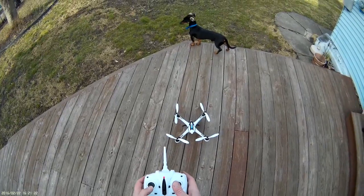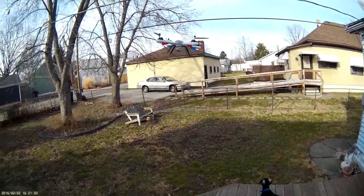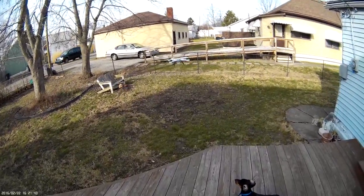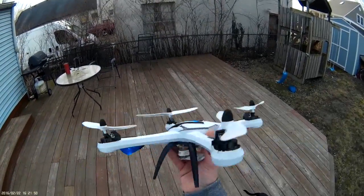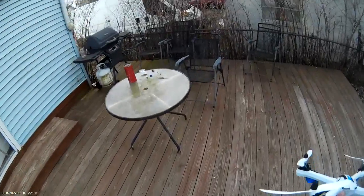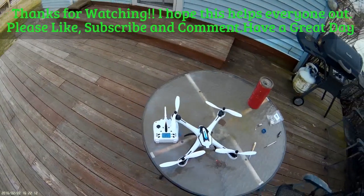It is spinning counterclockwise, which is right — that is the correct motor. I'm assuming the wires are color-coded: red and black, and white and black. Let's see if she gets airborne. Looks good to me! And there you have it — that is how to easily change the motor on your Yizan Tarantula X6 quadcopter and how to tell if it is bad. Very simple fix. Thanks for watching — if you found this informative please subscribe, and everybody have a great day. See you all later — this is Quad Flying Mav.